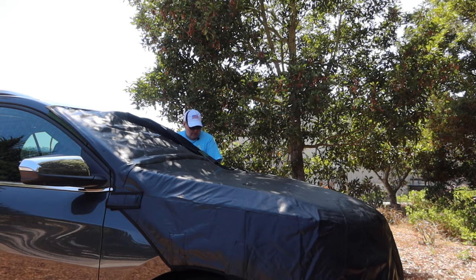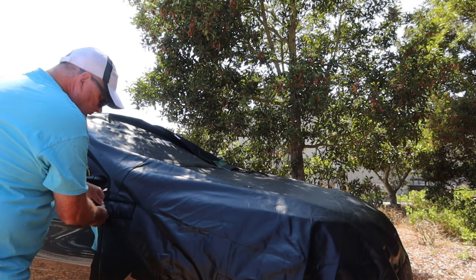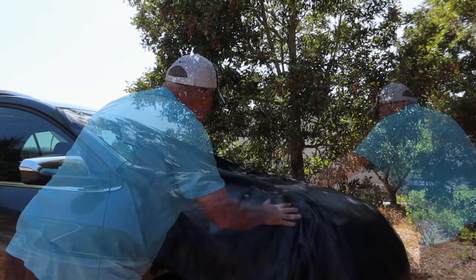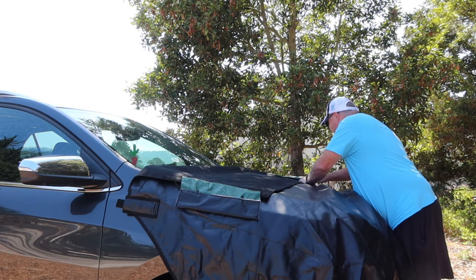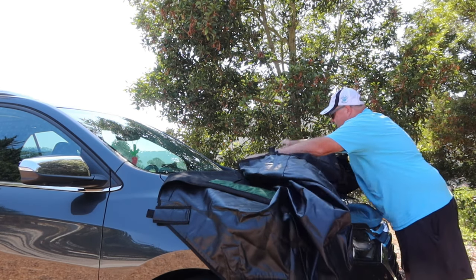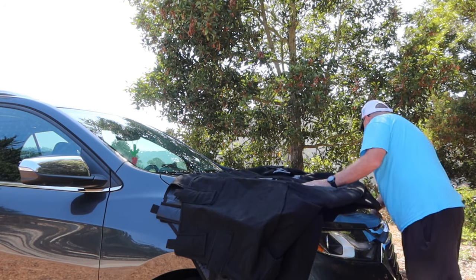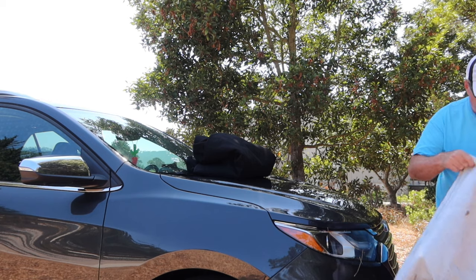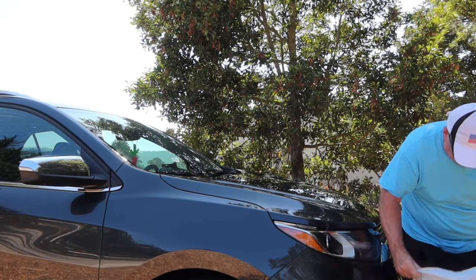I'm just taking this off slowly — not rushing. These tabs that you bent in place, you're going to have to straighten out when you fold it; it'll fold up better. I'm leaving the top windshield attached for right now simply because this hood is so slick and it's pointing downhill — I'm afraid the whole thing will slide off and I don't want to get the inside dirty. Two little snaps — fold these in, take the bottom and fold it up as best I can to keep it from sliding. A minute and 50 seconds is how long it took me to get it taken off, and we're done.